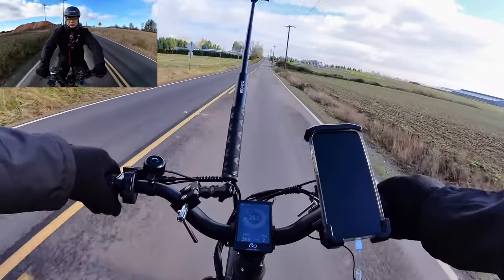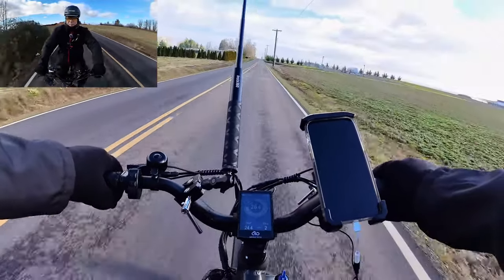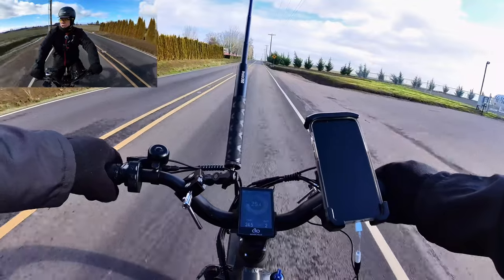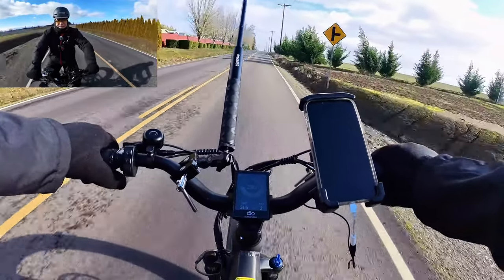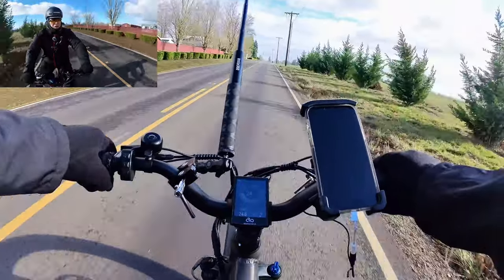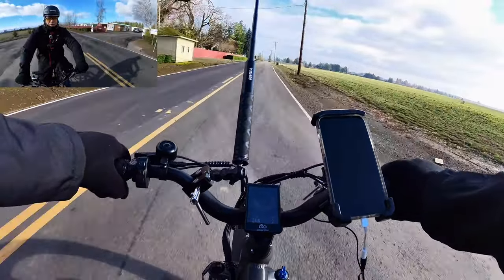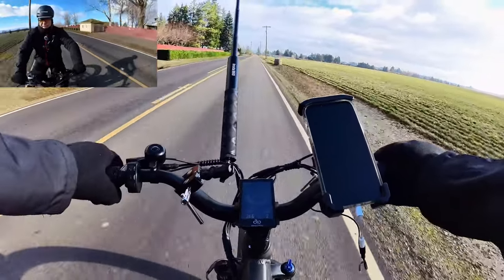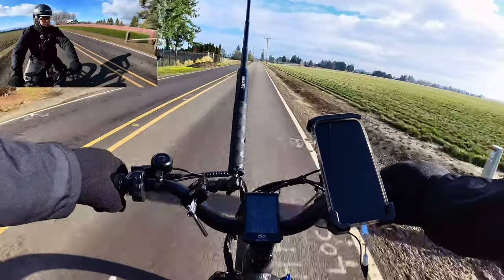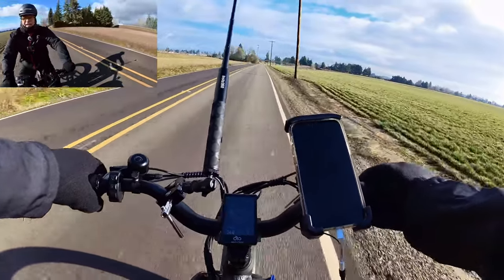Yeah, and I'm low on battery. I didn't charge it fully because I just wanted to get out on it and been busy. But she's doing 27.2 miles an hour at 83% charge. So I'd imagine if I'm 100% charged with my body on it, she'll probably get right at 28. Now the little Ocelot Pro with me on it, same bike, basically just smaller, doesn't weigh as much, gets around 28 and a half or so with me, maybe 29, a little faster than this bike, to be honest, but it's the same principle. This just has a little more weight, and when you have a little more weight, that's what happens. I'm currently running this at 28 pounds of pressure in the tires, and it feels really good. When you pedal, you can feel a little bit of the bounce, and that's pretty good too.